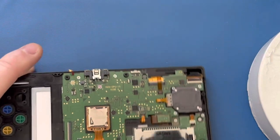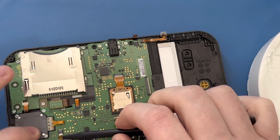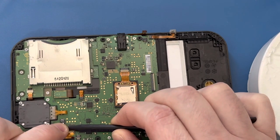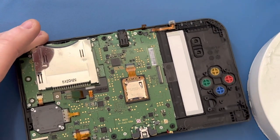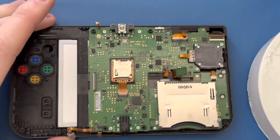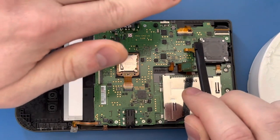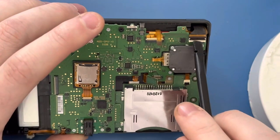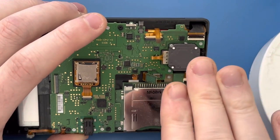This one is probably one of the more stressful ones — put this under here, put your finger on top to give it a tight grip, just pull back. And then this is a tab — we lift up — and this is a pull-back tab too. These are actually designed really well. You can tell by whether the flap is white or black which way the cable is supposed to be facing. This will help you when putting it back together: if the tab is black, the cable is facing shiny side down; if it's white, the cable is facing shiny side up.